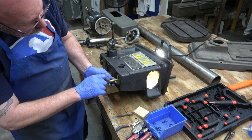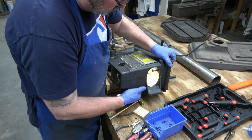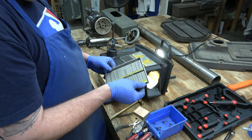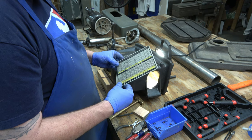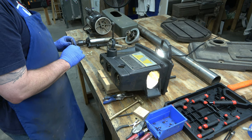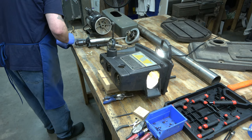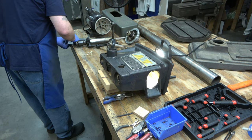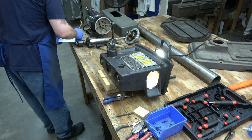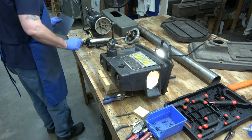The back ones are the hardest because you've got the smallest area to work with. But you can see the panel dropped out — and there it is. It's still got all four of those drive screws stuck inside the panel, which is not really an issue. I've got a couple holes in my workbench, so I can just lay it over one of those holes and tap them out of the panel. That way we're not bending the panel trying to tap them out.